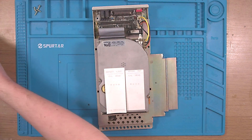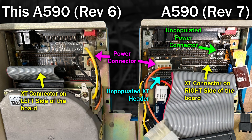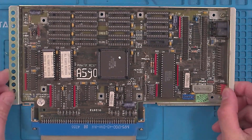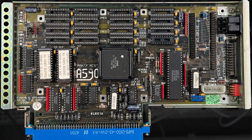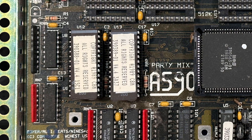Now back to the drive side again. This has to be a revision 6 board given the placement of the XT and power connectors. Removing the hard drive platform and taking a look at the PCB, a close-up reveals it's not configured with any RAM and all the RAM sockets are empty. It's got revision 4.4 of the ROMs, so now at least I should be able to check if the ROMs I had in the other A590 were indeed 4.4 as well.